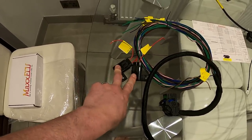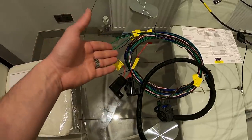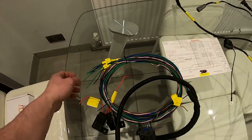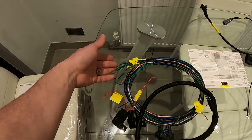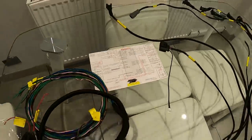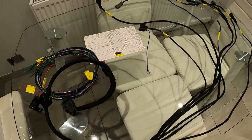On the inside-car side of the harness there are two built-in inline fuses — one for the ECU and one for the coil. You can connect these together and then just need a switched ignition live to feed them. I've also left all the extra cables wired in — CAN and stuff like that. The two blue wires are both ignition feeds, which you can use for fully sequential operation. The green wires are outputs for things like fuel pump, cooling fan, rev counters. I highly advise reading the online manual on the Max ECU website before you even contemplate buying this — it will give you a general idea of what you're getting into. I don't want to scare people off but I want people to have a proper understanding of what they're buying.